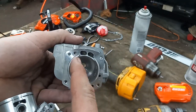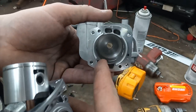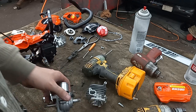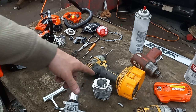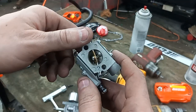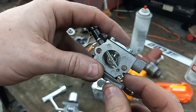And then I didn't show you guys what this looked like before, but in my other videos you'll see stock ones of this, and this was like a restrictor or whatever. I popped that out and did away with it. But if you do go as far as I did on this, the carburetor barely feeds it. You'll be surprised because you'll be out 3-4 turns on the high jet. This carburetor's teeny weeny, and the little Venturi in there is super small.